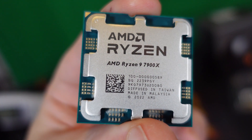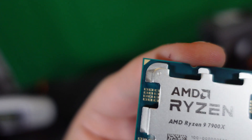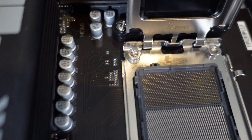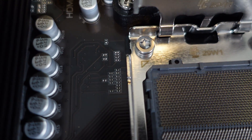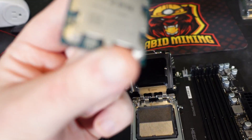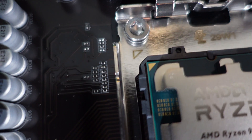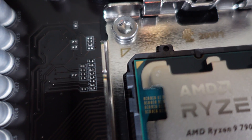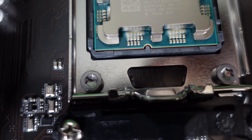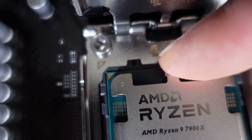This is pretty idiot-proof, but always do your own research. There is an arrow on your motherboard and an arrow on the CPU — you match those up for the proper positioning. Our CPU is in place with the two arrows matched up in the top left corner. It also has little clips that lock it in place, so there are a lot of ways to confirm correct orientation.